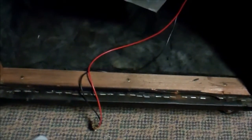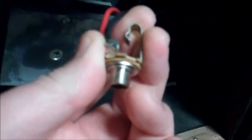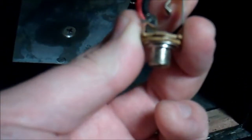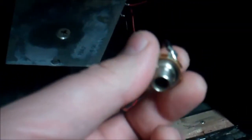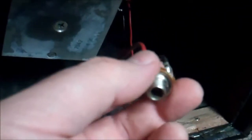We're just going to clean and polish the input jack, make sure that it's corrosion free and gets a good grip on the cable. If it doesn't, we'll replace it. This looks like a generic Switchcraft. Looking at how it sits, it looks like it might have been a little bit sprung — like somebody had pulled on it real hard. So we can probably polish it up, bend that tab, see if it's nice and springy and we'll get a good grip on the cable. If it does, it's good and it can stay. If it doesn't, it'll get replaced.